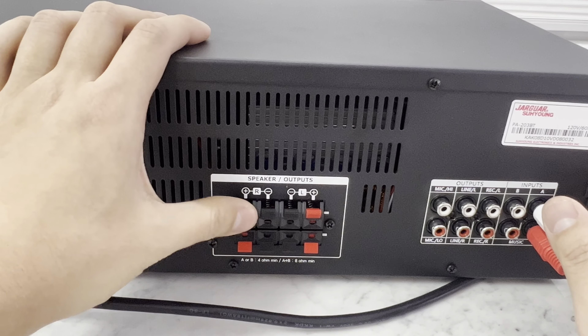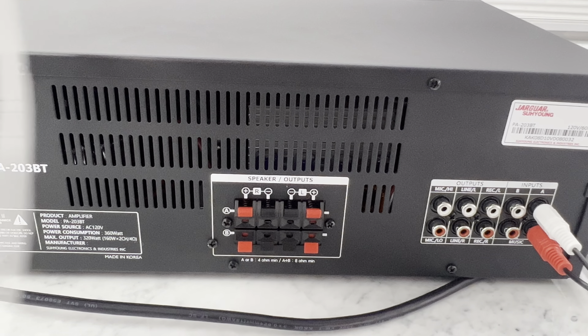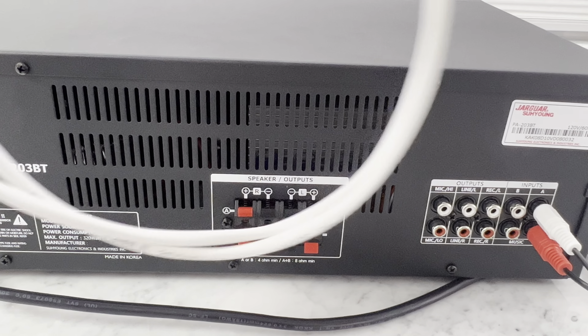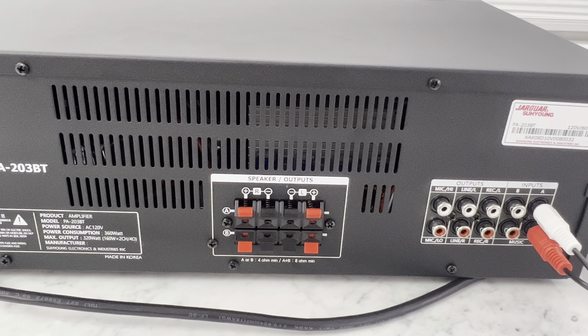Microphone out is just the mic-only sound — we don't really need that. The recording out is a spare for recording studios, but most people aren't going to use that. Your speaker outputs are here — they use speaker clips. A and B, that's two sets. Plug in two speakers: right and left is set A. The second set, right and left, is set B. Don't cross them or anything like that — you're going to get some weirdness, or burn it out. Speaker wire is included in the premium package, or you can buy it separately — 15 or 25 feet. For most home usage, 15 feet is good.